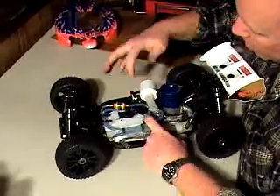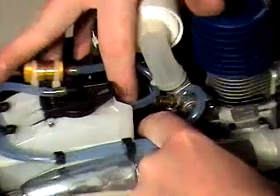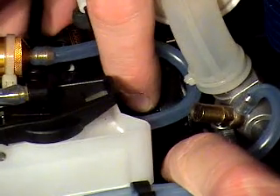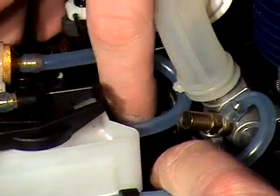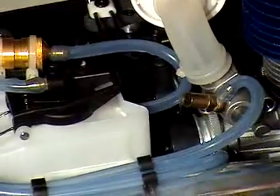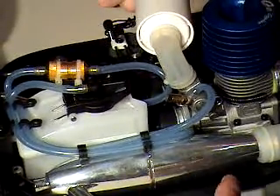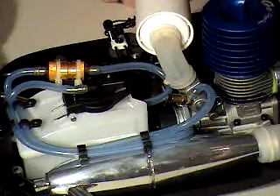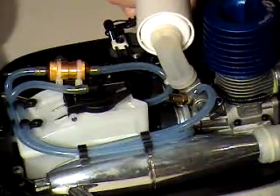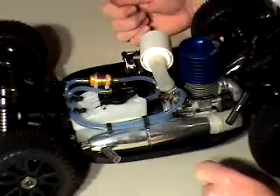We want to make sure that these two gears fit together, but not too loosely and not too tight. If it's too tight, you will wear out one of these pieces and have to buy a new one sooner than you'd like. If it's too loose, that's just as bad — you will chew up the teeth. These buggies have a lot of power and torque, and you can break teeth off real easy if it's not set just right.